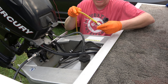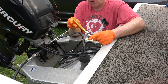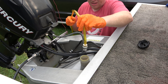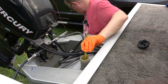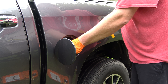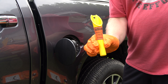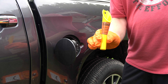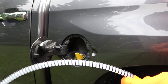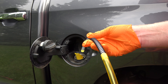The first step is to take the yellow hose — the one that does not have the spring on it — and put this pickup end into the fuel tank you're pumping from. The next step is to set up the line going into my truck's fuel tank. I'll remove the cap, then use the funnel which will keep the metal flap inside the gas entry point open. Then I can insert the spring side of the yellow hose down through this funnel and we're ready to begin transferring fuel.